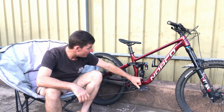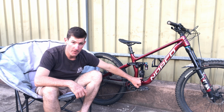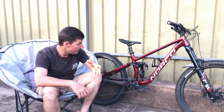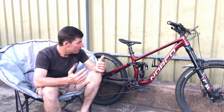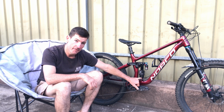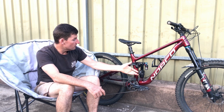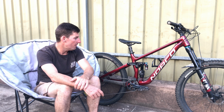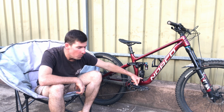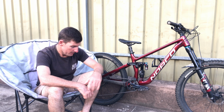So the fast high speed rebound, that's your grip dial. That's your grip dial and your rowdy dial, pretty much. So faster is more grip and more rowdy. So you got to back off the rowdiness, but don't back off so much that you start sacrificing grip, because a slower high speed rebound will kill your grip and it will kill your compliance as well, because the shock's not getting back to the supple part of its travel to catch the next bump. So started with 2 clicks from full open, ended up at 3 clicks from full open. Let's double check that.